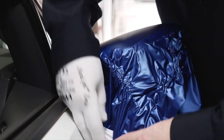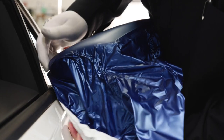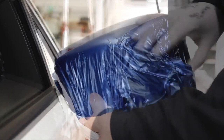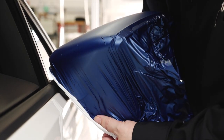Lift up the film from the vertical part and remove wrinkles. Make sure not to lift the film from the round edge. Fix the film along the upper edge and use the heat gun to remove wrinkles. It's important to hold the film with just a slight tension.